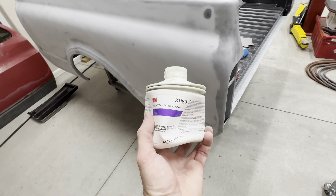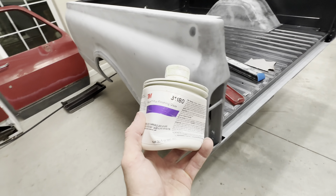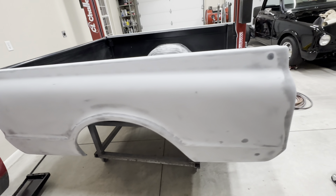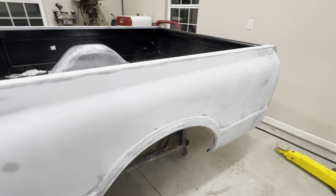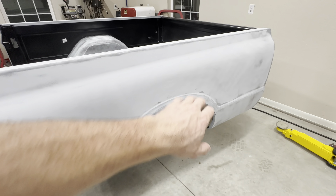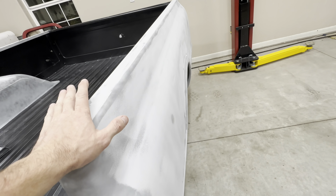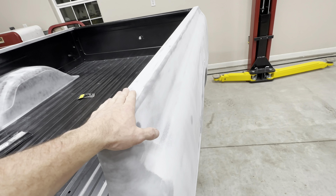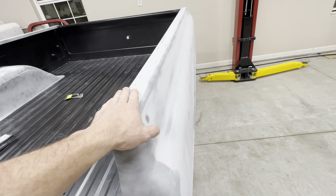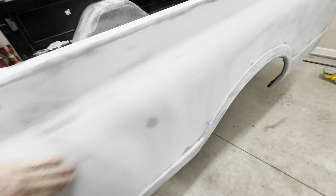This one is no good — it's all hardened up. But this is the stuff I'll be using to do the lightweight filler to finish out these low spots. Overall, it did turn out a lot better than I thought for the initial prime. I'm going to hit these low spots with that lightweight filler, block it down to 320, go over the whole thing, and then hit this with two to three more coats of K38 primer, block it down, sand it down. I'll do the final sanding as a wet sand with 400, and then it should be good enough for paint.